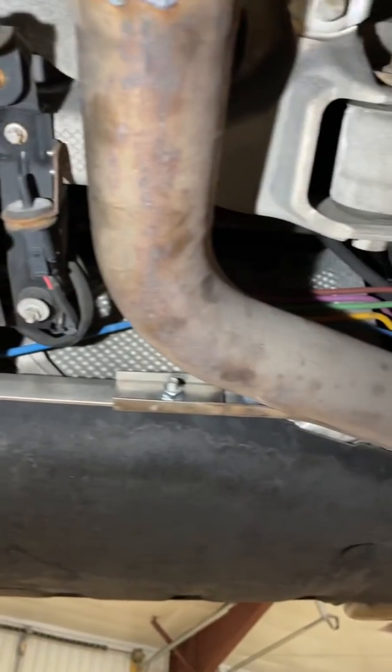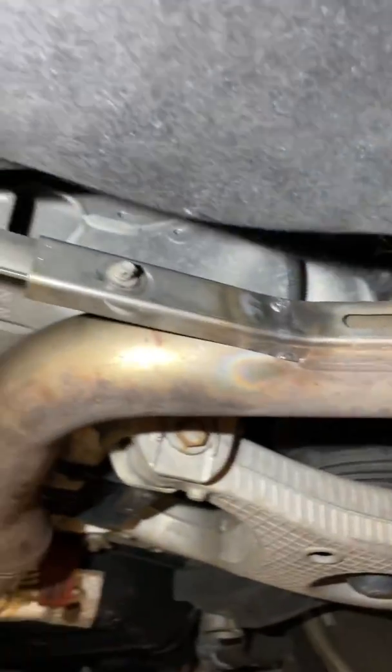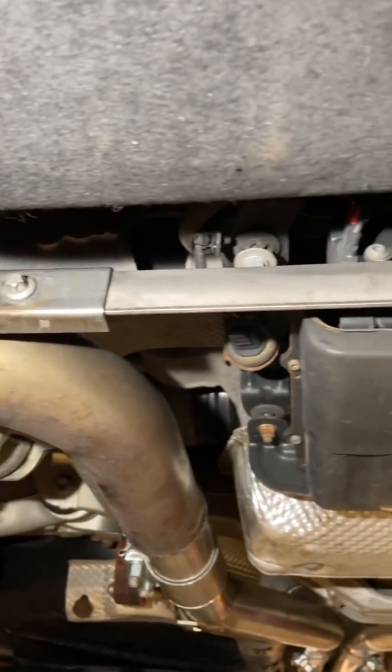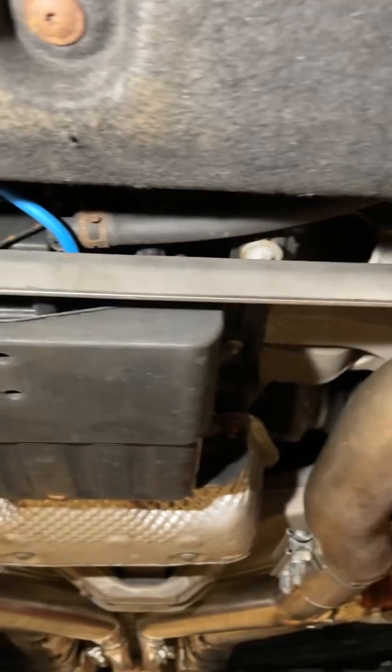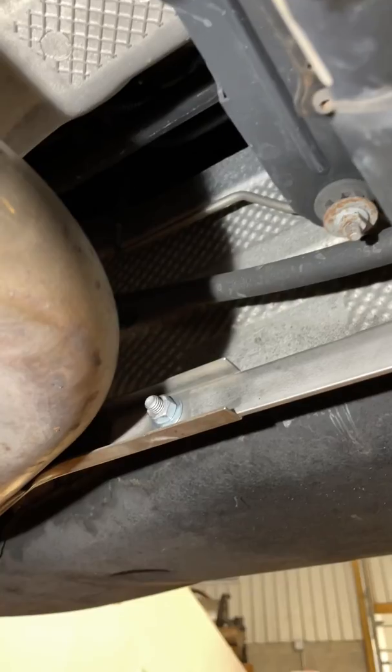And additionally, the rear brace that connects and supports the two rear muffler boxes was missing. Also, these brackets were badly bent, so we had to heat them up, get them back into shape. Took a 1-inch flat stock, 1/8 inch 304 stainless, ripped it down to 7/8 of an inch to fit in between the flats. Made us our cross brace, because without this cross brace, all of the weight of the mufflers rests on this clamp, and it's not enough.